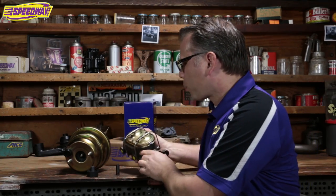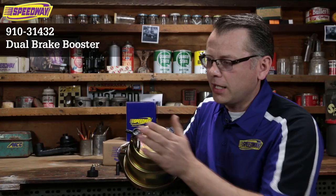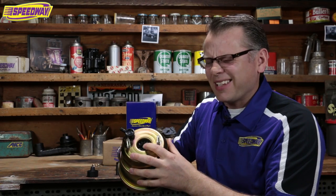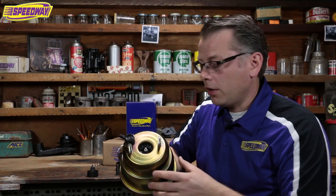The most common problem, however, has to do with the booster. Inside this booster there's a little push tube. This actually pushes against that spud and then into your master cylinder. This is actually adjustable. What most guys don't realize is they bolt this thing all together and it's adjusted out a little bit too far from the factory. So it puts a little preload on the master cylinder — it doesn't allow the piston to draw all the way back — and then it can cause the front brakes to lock up and other issues.